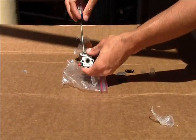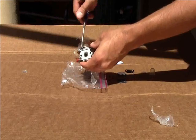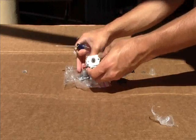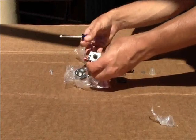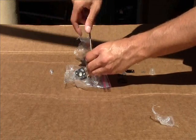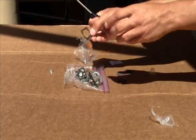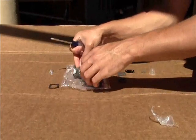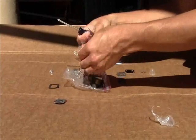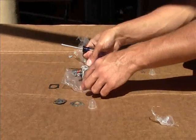Real simple. Just Phillips screws all the way around. Take these out. Okay, like so. So gaskets are going to be replaced. Backside, take that apart too, it's already loose. Mains of our diaphragm. It's totally blown out. Put our old parts over here. We'll be reusing this, reusing that. Primer bulb is new. We already cleaned all this out.